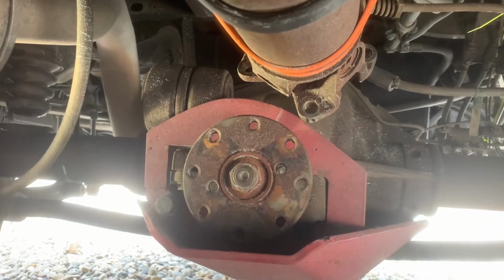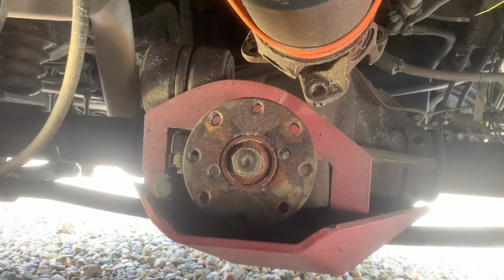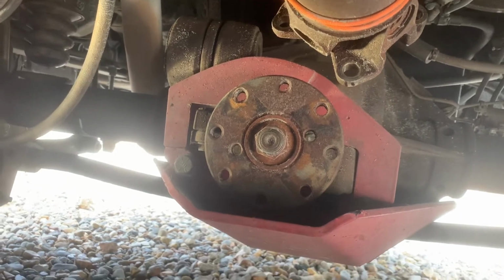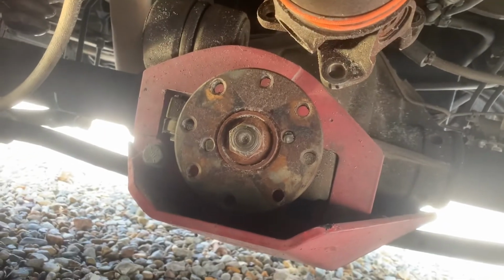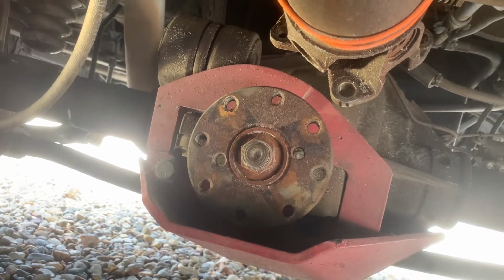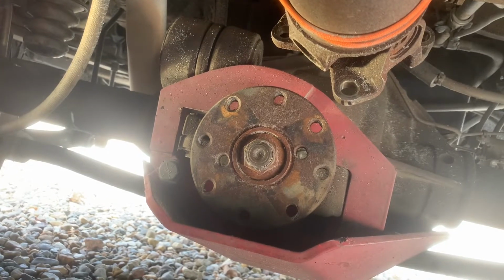So we're sitting here looking at the back end of the drive shaft coupling on a 2018 Ford T250 Transit. This has been removed for flat towing, and that enables it to be pulled with all four wheels on the ground. This is the only thing you need to do in order to flat tow it, aside from making sure your steering wheel does not lock, which you resolve by turning the key one click. Then you are able to flat tow it. That's all that it takes.